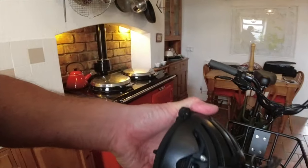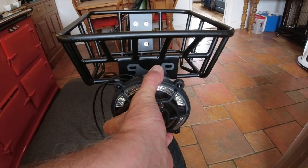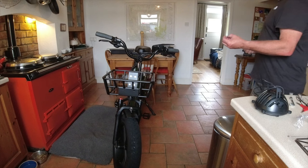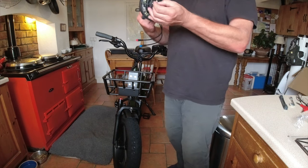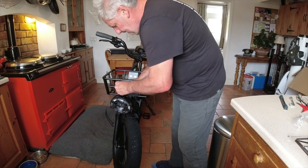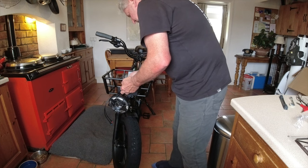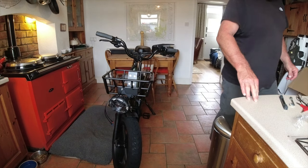Light. It's got a bracket on the back. That bolts onto there, nuts and bolts onto there. And then there's two wires there, which I guess go into those two wires there. So we'll take another Allen screw, put a washer on it. Take the light, cables out the bottom, through the slot, through the hole, and without dropping it, a washer on the back, and a nyloc nut on there so it doesn't vibrate loose. And then we have another one, we'll do the same with that.